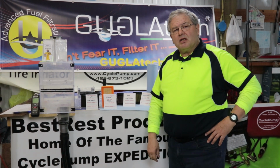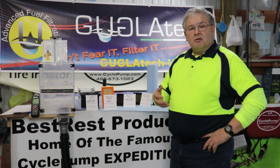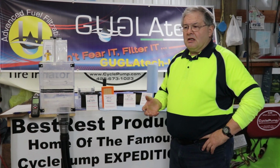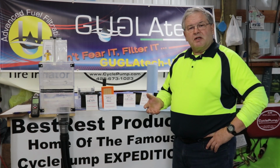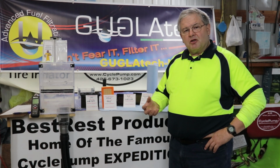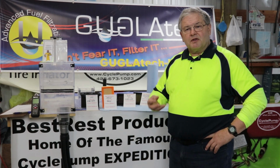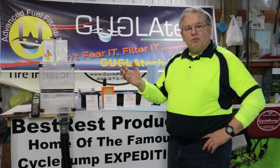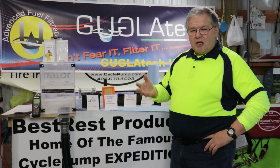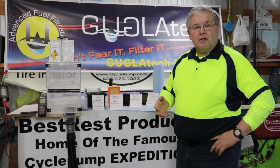Now, in talking to the K&N expert, I asked him some very specific questions about how much oil you should use on the filter when you're re-oiling it after a service. Basically what he said is, yes, you could over-oil it, but because of the vacuum created by the engine, any excess oil is going to be sucked into the engine itself and go through the injection system or the carburation system. So you can over-oil, but it's better to err on the side of having enough oil than not having enough.